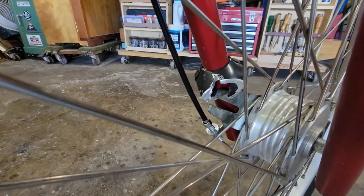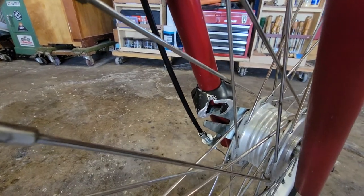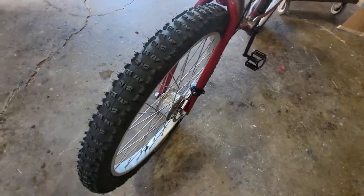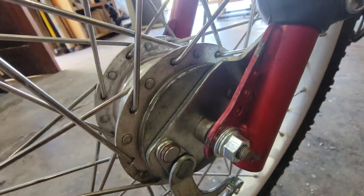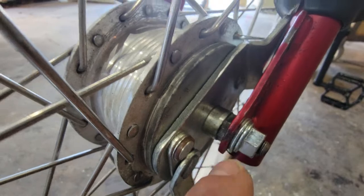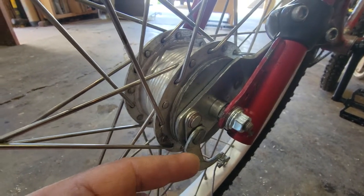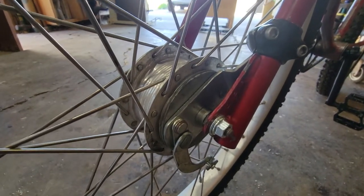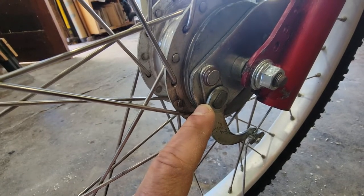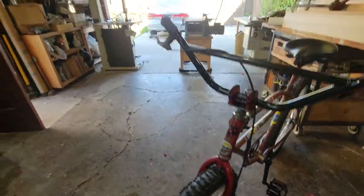What I did there — all that's doing is wedging it; it's not even bolted in place, but it can't go forward, and that's all that matters. That's the mount that stops the brake arm. I took this apart over the weekend and did a short video on it. You just remove the wheel from the bike, remove that stop nut — it's just a spacer — and this whole cover comes off. On the back side there are just two springs with your drum brake pads. I put a dab of grease behind there; I don't think that's an issue but maybe it is. I'm going to get some brake cleaner and clean this out. I've got this adjusted pretty well now — it's like a drum brake on a car.